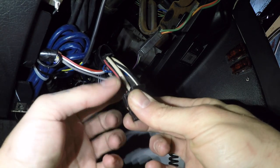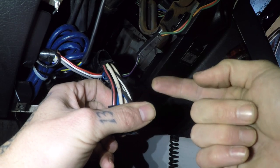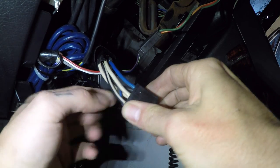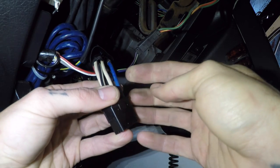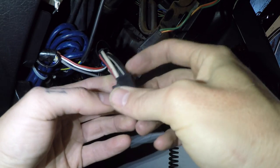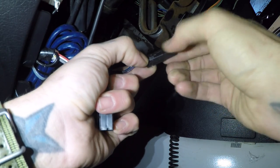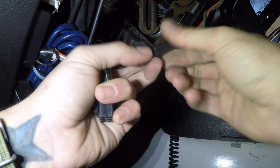As you can see, there are two white wires that provide power to the key lock cylinder. There's also a black with red which powers your wipers, heater blower motor, headlights, cruise control — all your essentials. The black with white wire is your cigar lighter and radio, system power antenna, anything connected to the radio. The black with blue wire is the start wire, and then the blue wire powers your ignition system, your computer, and all that stuff.